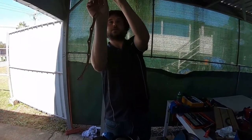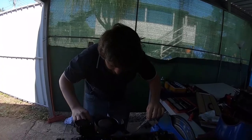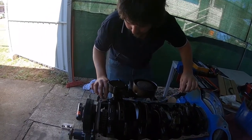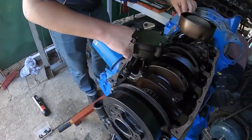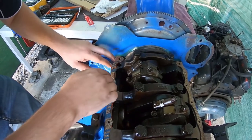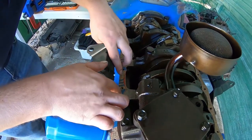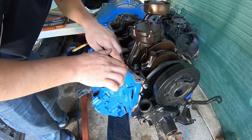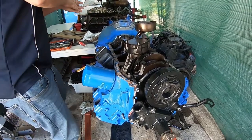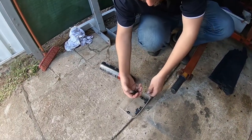So this one's ready to go. Spin it over gently, careful not to drop it. I actually don't really like these cork gaskets — there's a Felpro heavier-duty rubber-reinforced version I do like, and I should grab one to show you the part number. But because we've brought a Felpro gasket kit to do this job, we're just going to use what came in the kit.